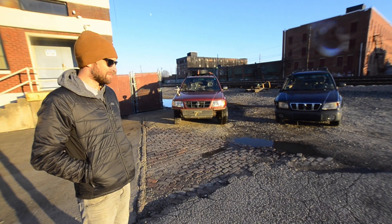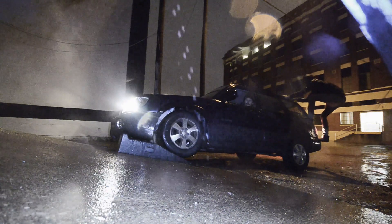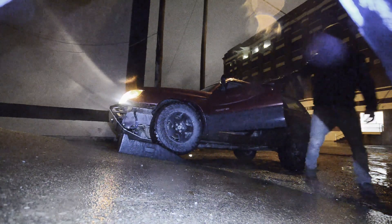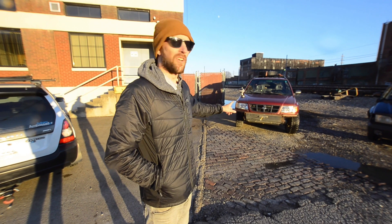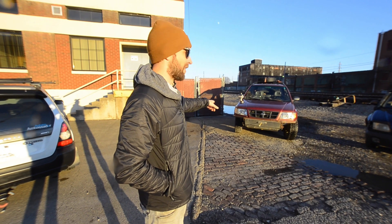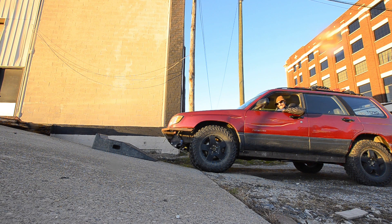We saw some tantalizing results in a previous test suggesting it might be able to transfer more to the rear. It made it partway — roughly the same as what Bluebaroo did. There are a few things that confound the results: Granny is definitely heavier with all the extra equipment, and she also has a bigger tire size. So for a given incline, Granny is going to need more torque at the center to get up because she has a slight loss of reduction from the tire.